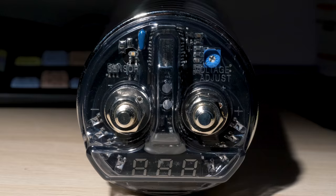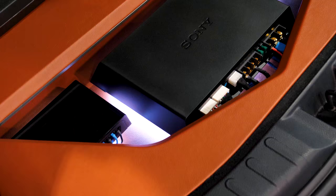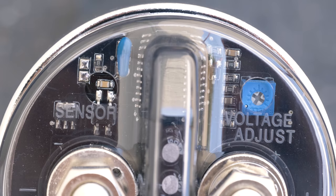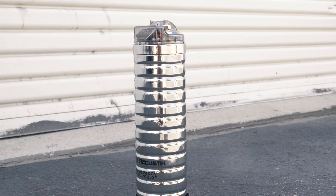Its power is always instantly ready for the amplifier if it needs it. Capacitors improve the electrical system by providing a buffer between the alternator and the amplifier. So when you're hitting really high bass notes and the amplifier is drawing more current than the electrical system has stored directly, the capacitor basically covers the difference with its stored power. This way your battery doesn't get overloaded and the car voltage remains the same, ensuring your music will never go flat.